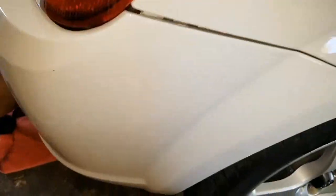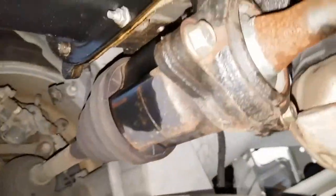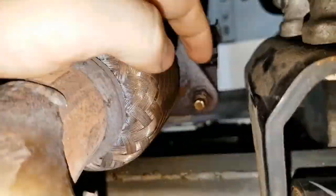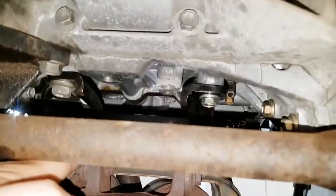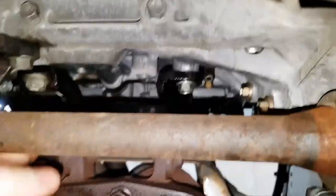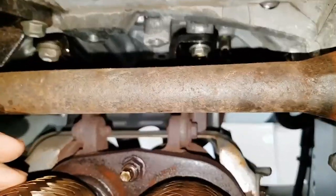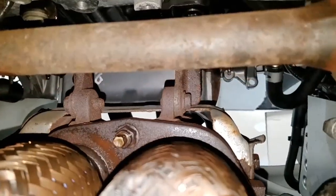So while these top bolts are soaking, we are underneath the car right now, removing this plastic cover. We are underneath the MR2, and you can see these three nuts have been soaking. One, two, and the inner third one's right over around here. And then this bracket here will have to come off. That helps it from vibrating. That's why they put these two brackets right there, to help keep the porcelain from rattling loose on the inside of these. But really, once you pop these off, we're good. And then take off the manifold five bolts.